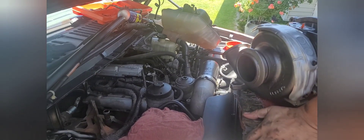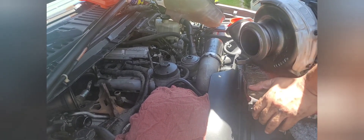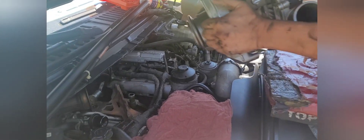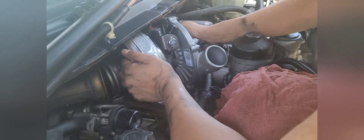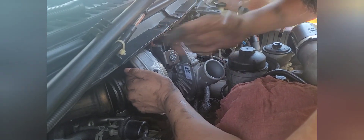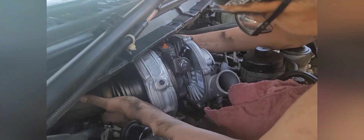Now here it goes — putting the turbo on. You want the exhaust housing facing the back, and your Y-pipe just has to get set on the turbo. Once you're in, you can see the O-ring for the turbo drain tube — that's what you want to set the turbo on. Be careful because it happens all the time when you're trying to set it: you're going to pull the drain tube out from the high-pressure oil pump cover. Try to do it smooth so it doesn't pull out and it mounts correctly.